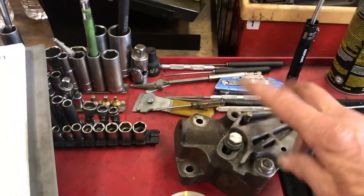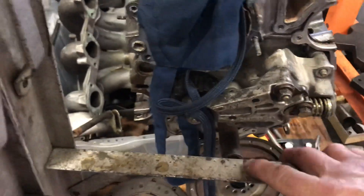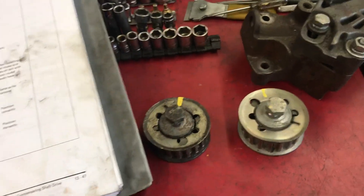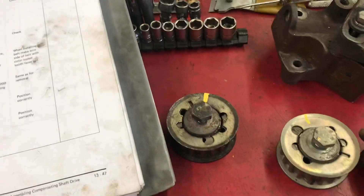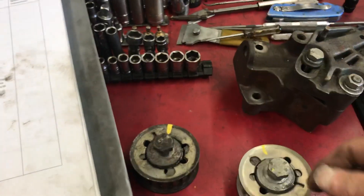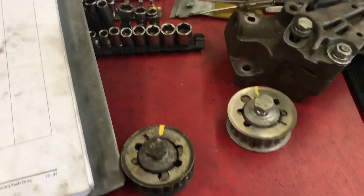There's also an aluminum tensioner hiding behind the ladder here — a later one, a nice little weight savings. So to summarize on the balance shaft sprocket gears: there are only two things to remember. The keyway always goes up, and then on the upper one the O goes up, and on the lower one the O goes down. Pretty simple.